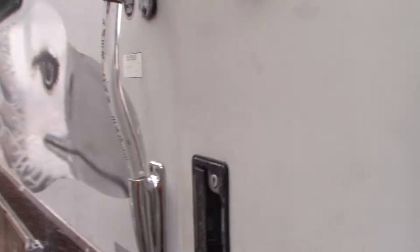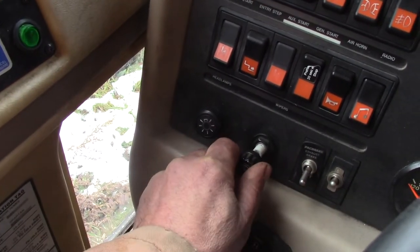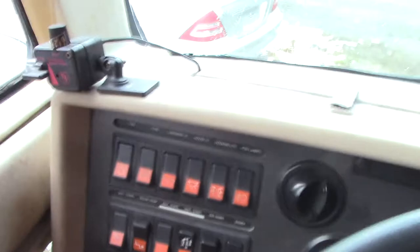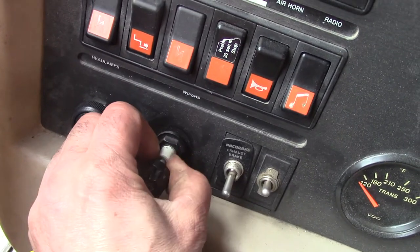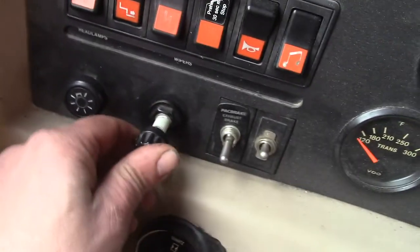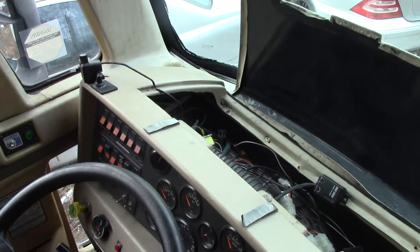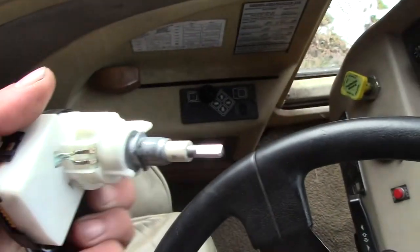My next suspect is the switch. The switch in the old American Eagle is this guy right here, and I've already started messing with it a little bit. This switch just doesn't seem to be doing it — I guess that's the problem. This thing's already broken; it's got an extra knob here. It says fast, slow, intermediate, and that turns this little white sleeve here. I thought if I get that to turn, I bet it'll get working, but it doesn't. So I'm going to have to pull the switch out. Well, that was easy — just pop that cover up, reach right down there. It's a six-prong plug; that's the other end of the switch plug. I got the switch out pretty quick and easy. I'm going to go in the barn now and tear the thing apart and see what I can figure out.